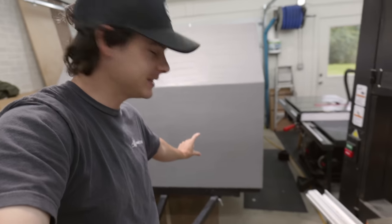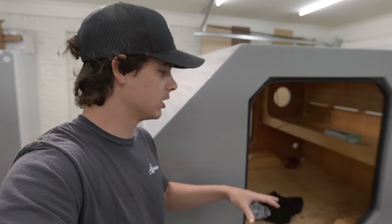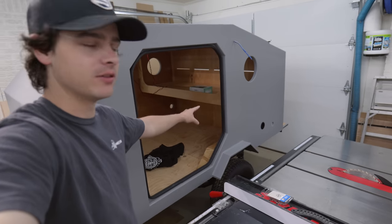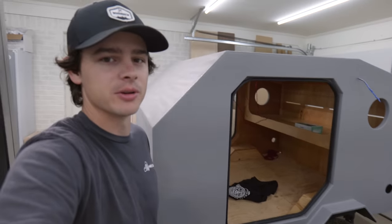And then the very, very last detail, once all the stuff is put on, we're actually gonna put a band that goes about 12 inches up of black bed liner on, which is just gonna give us even more rock protection and even more waterproofing, but it's also gonna have this nice aesthetic line, which is going to match up with the dovetail of the door. And it's just gonna go right across the bottom of this door, and it's gonna look really, really nice.